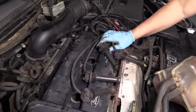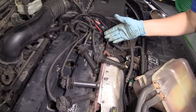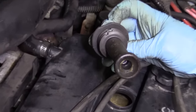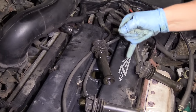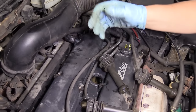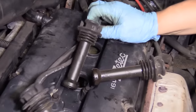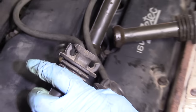Now I'm going to install the plug wires. Examine them before you put them back in. On this particular car, I'm going to replace them because the oil from the leaking valve cover soaked them. Oil causes the rubber to swell up and the spark will shoot down the loosened rubber and ground out on the block, causing a misfire. Plus it looks like something has eaten a bit of the rubber, so we don't know what else is compromised.